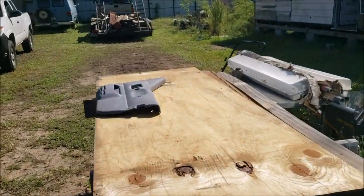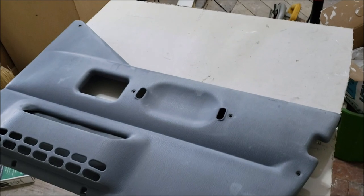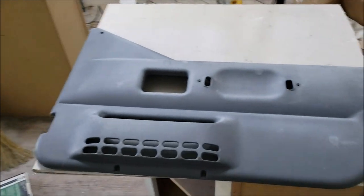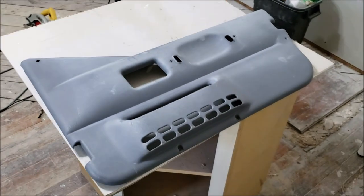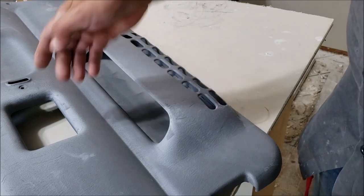The panel's finished drying — it's a beautiful sunny day, but you do not want to paint in the sun. That's one of the mistakes people make. If you touch this panel from the back, it's probably about 95 degrees. The paint we're about to use dries super fast and the last thing you want is to paint a hot panel, so we're going to let it cool down. It's about 70 degrees in this room.